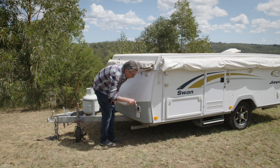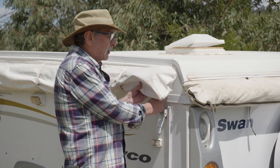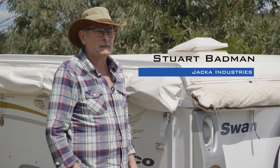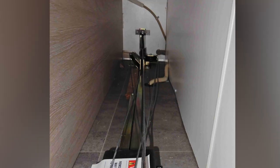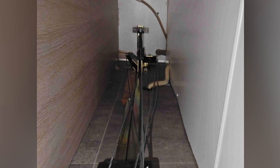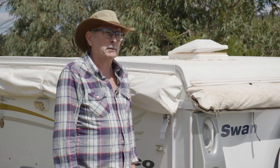Stuart's holiday ended when a winch cable snapped on his Jayco camper trailer. The cable was caught and holding the roof down, but he didn't realise it. He went to the winch, wound it up, and because there's no feedback or sensitivity in the winding mechanism, he didn't realise it was caught. It was too late and the damage was done — he straightened all the hooks out on the fish plate inside, pulled three pulleys off, and it pulled two springs out of the wall. Without realising it, there was a huge amount of damage done very quickly.